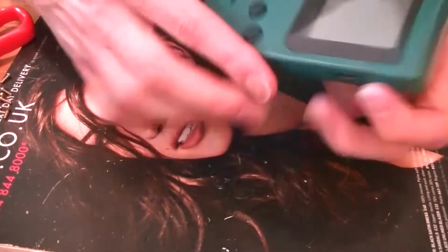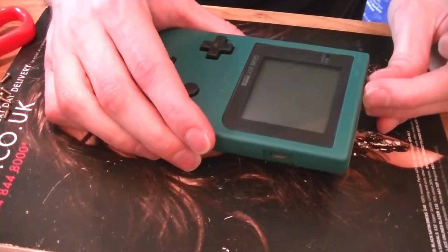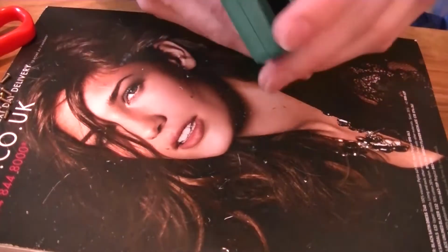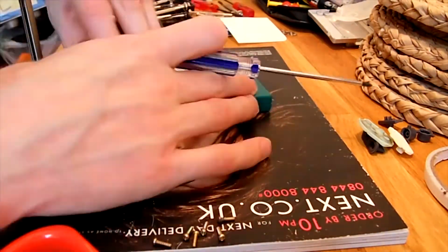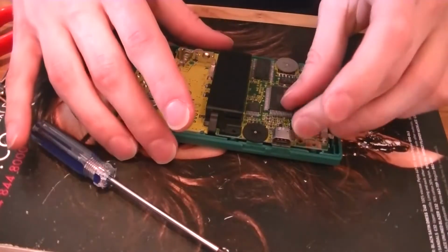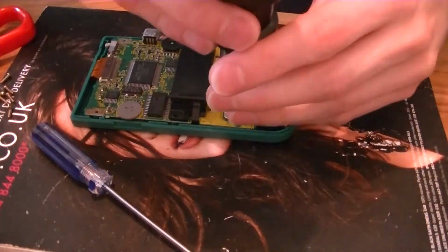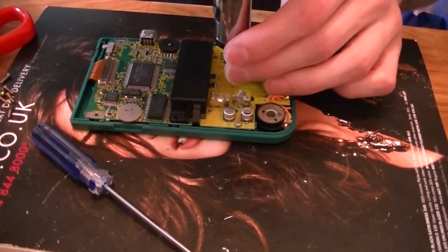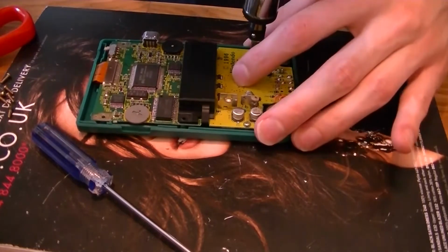That's interesting. The screen doesn't seem to be working now, so it does seem to be getting power, but perhaps the ribbon cable's just popped out a little bit. So looks like we're going to take it apart again. Well, the ribbon cable looks secure. Perhaps it's just this little bit here where I flexed the board a little bit too much by over tightening these inside screws.